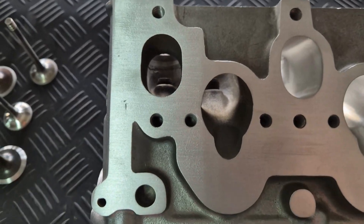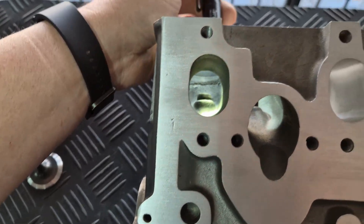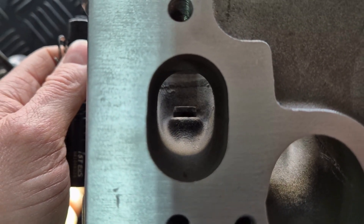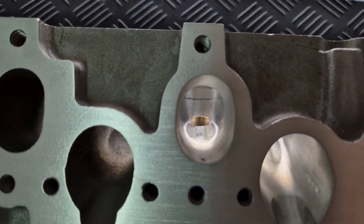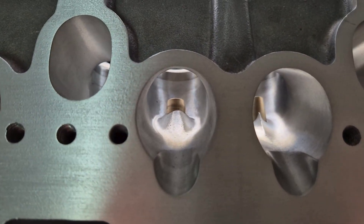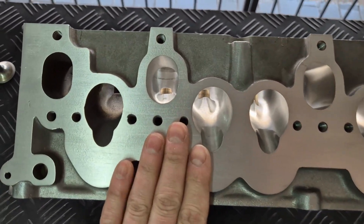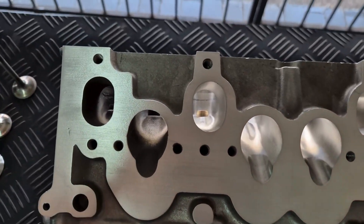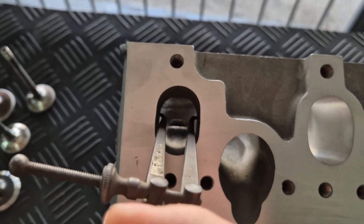Okay, then we get to the ports — the intake and exhaust port. I'm going to show you the standard ports. So that's your standard port, exhaust and intake. And then we go to your basic port — that's your basic exhaust port and intake port. Stage 2 basic is normally value for money; this is what most guys go for on the street, with a minimum 10% gain. Let me get my calipers out. So standard exhaust port with a caliper — as you can see, it's touching the walls. And we go to the one that's been flowed — it's already been opened up, volumetric efficiency.